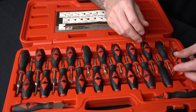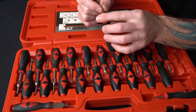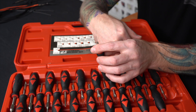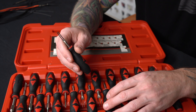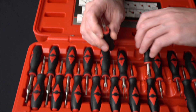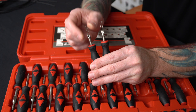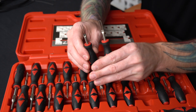Number 21 is for the smaller terminals inside connectors like D33 C40 and D33 D40 — it releases the smaller ones perfectly. We do the same quality control check on these 23-piece kits, because some come in with pins that are bent or not the right size. We either fix it or replace it, so what you're getting is the correct set. Tools like number 11 and number 6 are good ones for the larger pins. Some actually bow in slightly, which helps press against the releases inside the connector.